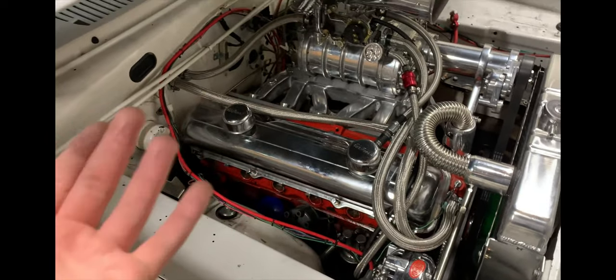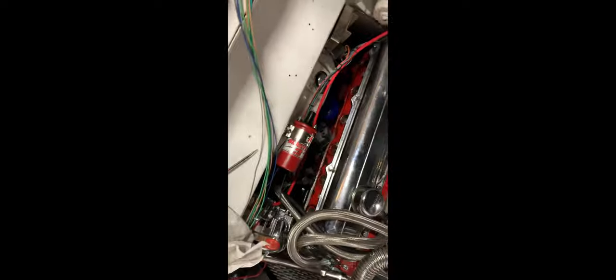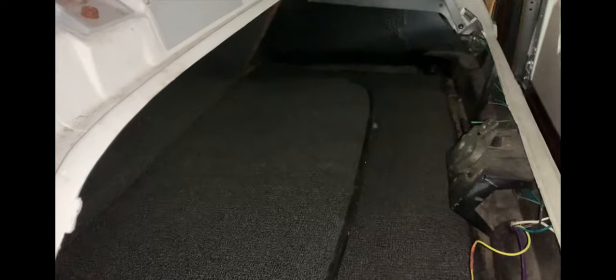With the electrics and the MSD 6 BTM we just reconnect everything and hit the ignition and see what happens. I've moved the coil up so it's away from the fuel pump and a little easier to get to. I decided to clear out this side of the bay — battery tray is gone. I'll clean and repaint it. This will be nice for cleaning up the wiring harness. Now I need to jump the engine to the frame and put the battery in the trunk. There's an aluminum battery box going in that corner with a vent drop through the drainage holes in the fender. The little hood scoop is on — it's for the tensioner clearance. I've sectioned that piece I thankfully saved; we're going to weld it around the edge and the hood scoop gets welded to the hood for rigidity.